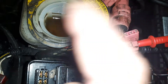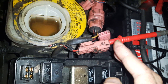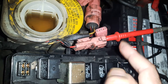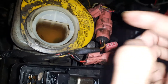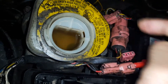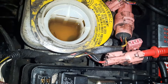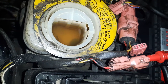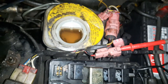Get it sucked in there, then activate the ABS solenoids the way I showed: black to the negative battery terminal, red to positive. The center pin is black, and the left and right are yellow and red. Test all three solenoids this way. If a solenoid doesn't click, that means it's not working right or it's jammed.